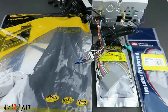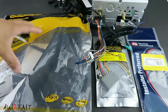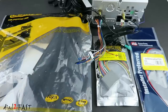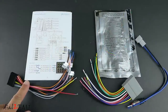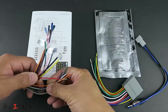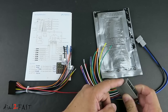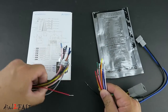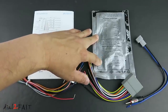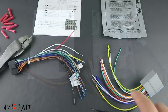To install the stereo into this Honda vehicle, you're going to need an installation hardware kit like this one. This has a shaped radio bezel, and you install the aftermarket radio into it. You also need a stereo wiring harness and an antenna plug for this Honda. Starting with the wiring harness from the Pumpkin Android stereo, I've cut off the ISO connector for the speaker output and power wire. On the right side is the stereo connector — one end connects to the car's factory harness, the other to the Pumpkin stereo wires. Match up the wire colors for power and speaker output and use butt connectors to crimp them together.